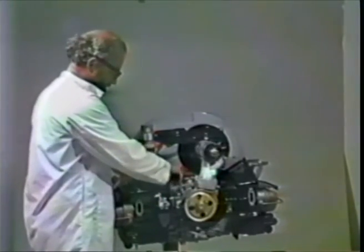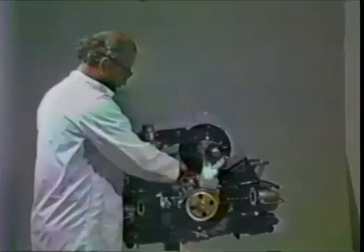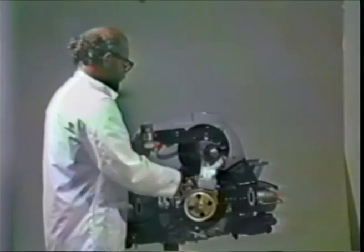Okay, have fun. Oil filter bracket, coil in place. Now, to leave no part unplated, we take out the fitting in the case. It feeds oil to the junction block and then the filter. We'll replate them. Voila, they're replated. We take the new copper gasket, put that over the fitting, put the fitting back into the case, like so. Tighten the fitting down. Don't let the wrench slip off the nut, or you can ding up the hex, which will usually ding up where the copper gasket fits.